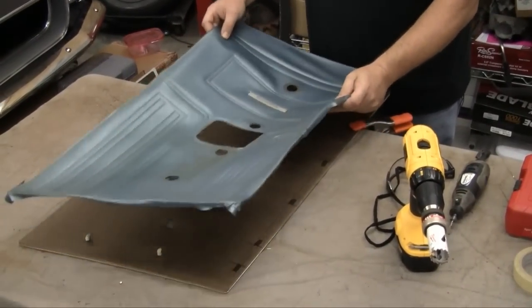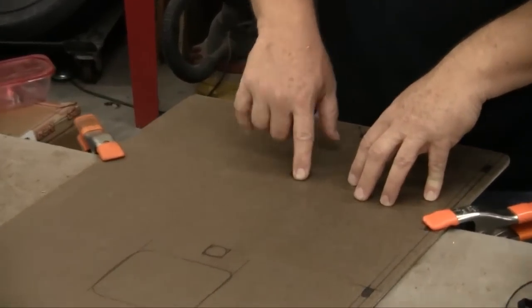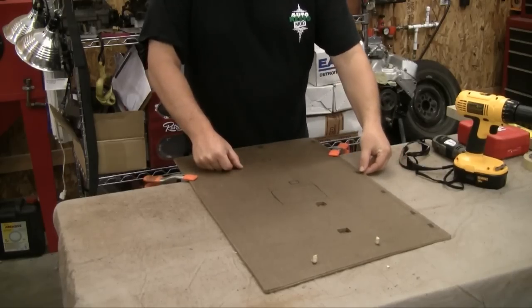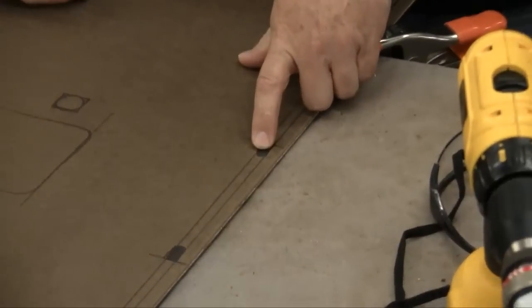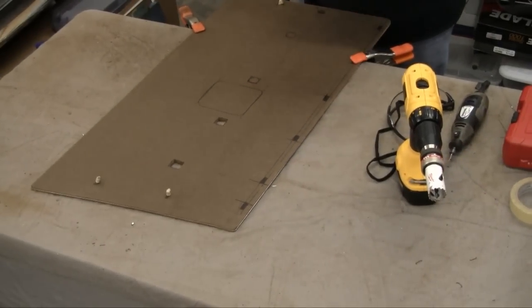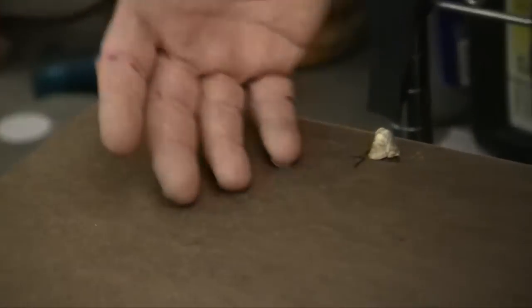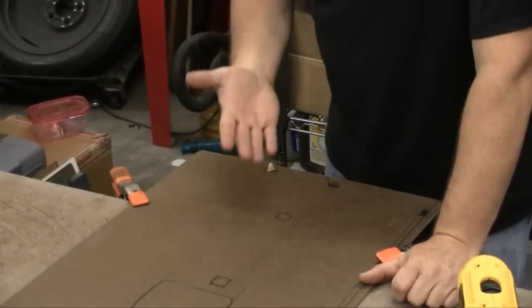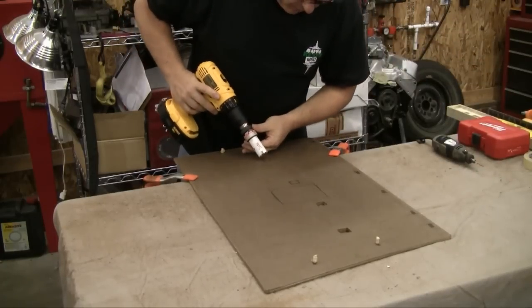I've done a final test on the panel board and set the vinyl skin aside to avoid damage. Now I'm cutting the hole for the window crank. I've also redone all the holes for the clips that hold the panel, because the originals were badly busted out — I did a guesstimate measurement off the bottom edge, which will vary by car. If you're using particle board screws, tape around them to protect your hands while cleaning residue off the board. Then deploy your safety glasses and grab a hole saw.